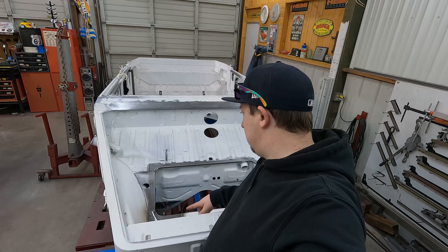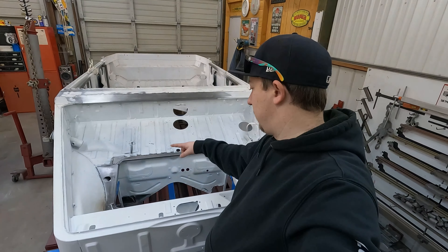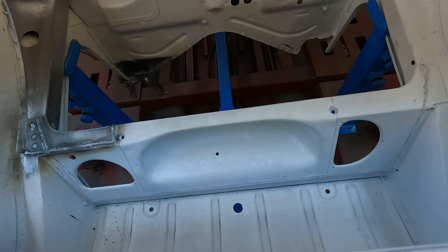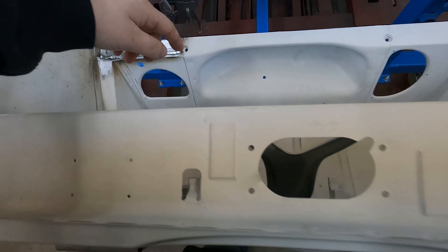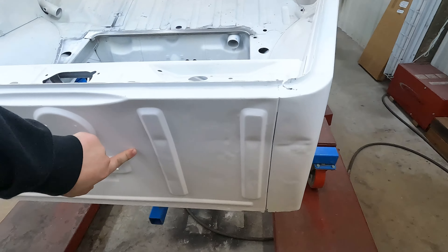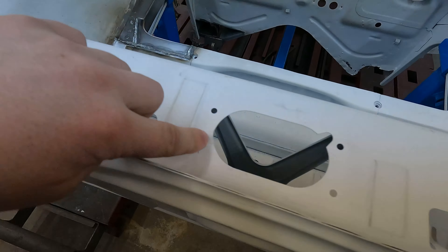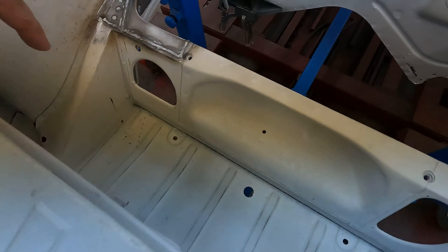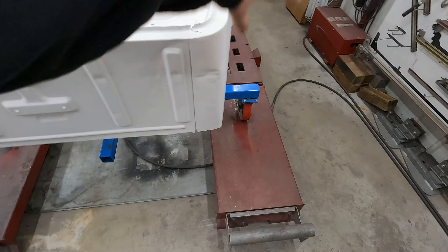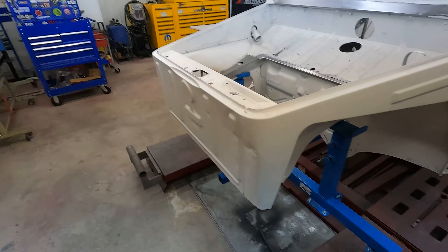The front — there's nothing else to do up here once that's welded in. We've got to weld that in, and then we're done fixing this. The floor has a couple pin holes in here. We're going to wait on that, because this needs replaced, and so does this. So we're going to wait until we pull this fender off, and while this fender is off, we'll pull this out, fix a couple of holes in here, put the new bottom plate in. We have new corners — put the corners in, put the front on, and then put the fender on. So we're kind of waiting on that for now.